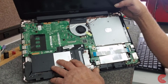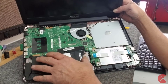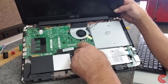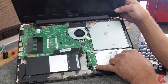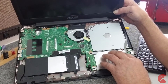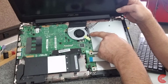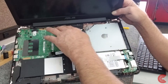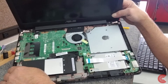We have our battery here — I'm going to take it out, it's got three screws. Then I'm going to take out the whole motherboard. There are two screws right here holding the hard drive — a little bracket holds it in, and you can replace that with a brand new solid-state drive. There's one screw right here to remove the optical drive, and a handful of screws for the motherboard. Let me get the hard drive out first.